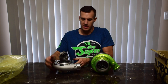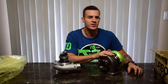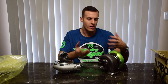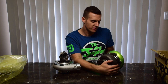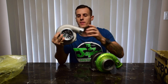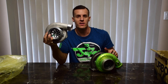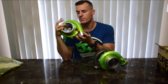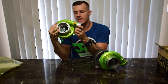As I mentioned, the turbine housings are interchangeable from Gen 1 to Gen 2. I'm running a T3 turbine housing on my previous Gen 1, and my downpipe and up-pipe have already been designed around the T3 setup. So all I have to do is unbolt the six bolts on the back of the turbine housing, swap it over, bolt it down, and I'm ready to mount the turbo back in the car. The only other thing I needed to do to the new compressor housing was drill and tap a hole for my boost port to feed the boost control solenoid valve — and of course powder coat it. With the magic of video editing, the new compressor housing is now powder coated with the boost pressure sensor fitting installed.